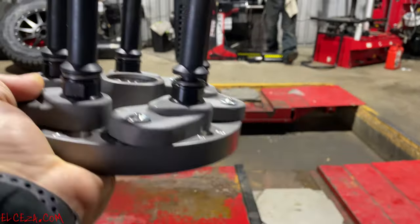It sees the spindle was here spinning, and then the rim should be spinning at the exact same RPM, but yet one of them is moving faster than the other. Hang on, it's going to give you that. Okay. Make sense? The lasers in this hammerhead are going to show you where to put the clip weights across the top. You're going to eventually figure out those are on spring bolts. Don't be that guy that runs by and just slaps that same weight on just to watch it do this.